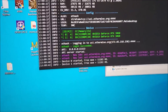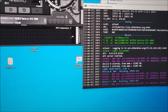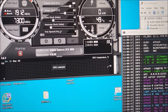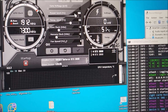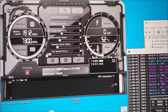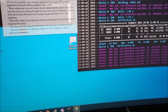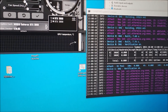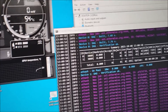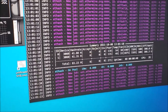Let's see how the other one's running — oh, they're both at 100%. I think it wiped my settings since they're linked together. I'm gonna pull the power down to about 80 right off the bat. You could probably crank the fans to about 70; we'll put them on 75. We'll bring the memory up — let's try plus 710. They can do more than that but let's see where everything lands. Sitting at 41 megahash right now, I'll do some more tuning and be right back.